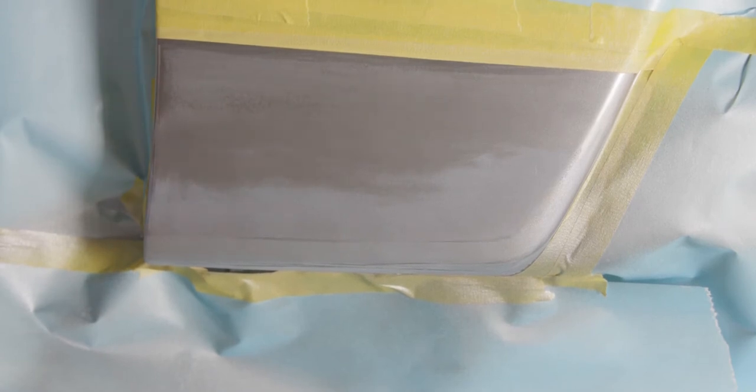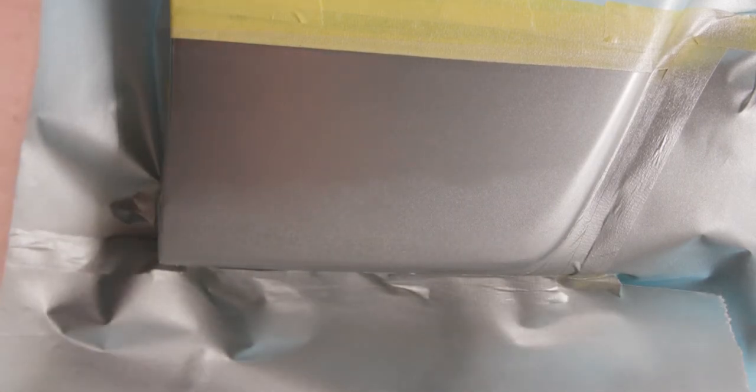Now we've waited the proper amount of time and we're going to apply a second coat, remember spraying downward. Put another light coat on it. We have our third coat in there — make sure that you have everything covered. Look around every area and make sure you have enough paint. Now we're going to do a little mist coat so that everything blends in. That's your control coat. Now that the color is applied and you have good coverage, you're ready for clear coat.